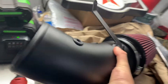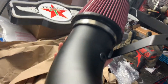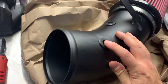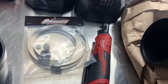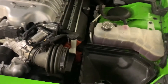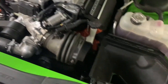I got my cover here. And I lied — it's not matte black, it's a flat black. It's got a little bit of shine to it and I actually really like the look and finish of it so far. I'm extremely impressed with what it looks like. Another difference from my other intake that I installed on my previous Hellcat — I really appreciate that they took the time and put the little rubber grommet in for you. There's a rubber grommet there to attach the intake pieces to the snout of the supercharger. I'm going to try to make these steps pretty quick — it's pretty self-explanatory: loosen this up, that's going to pull off, and obviously I'm going to pull this out before I do that.